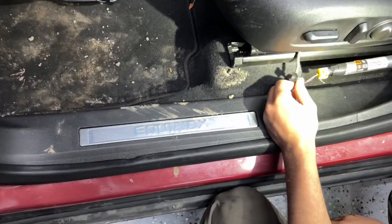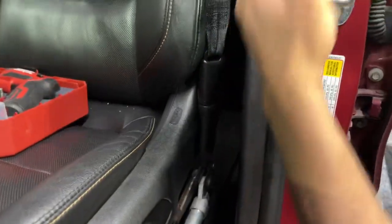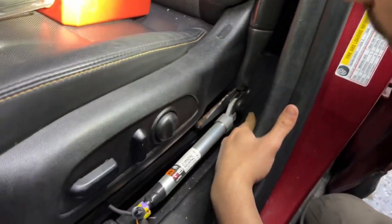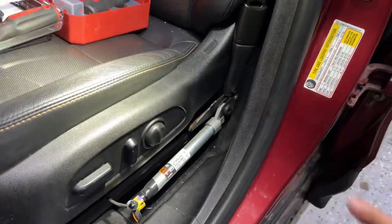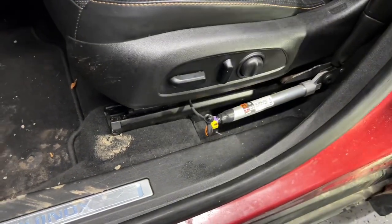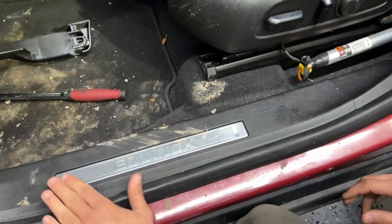We disconnected the battery again just like the first step. Now that we removed the pretensioner cover, we can move the seat back and forth for more space to access the full seat area. We need to remove the seat bolts and the entire pillar — both top and bottom. To remove the pretensioner bolt, a stubby socket makes the job much easier. If you don't have one, I'll show you the alternative using a normal T45 or T47 socket — though there isn't enough space for a standard ratchet.